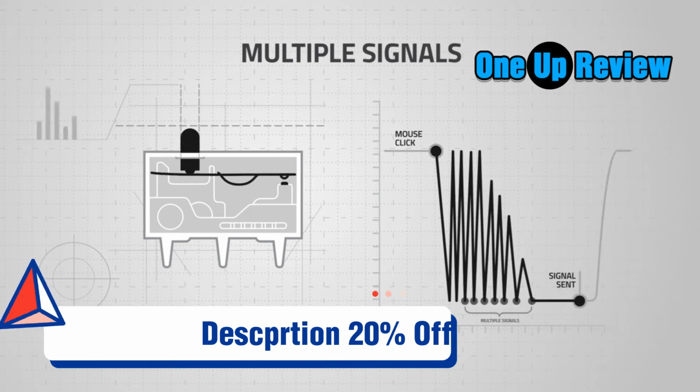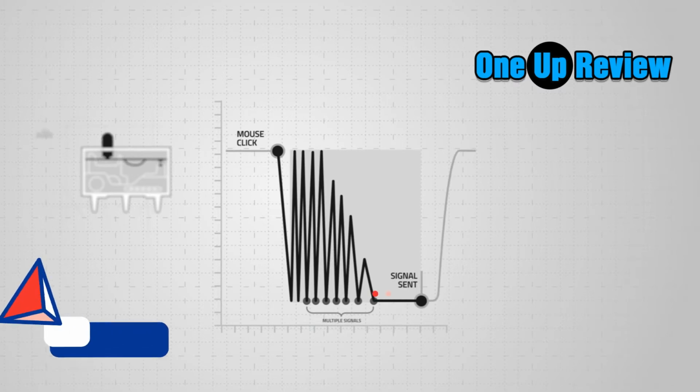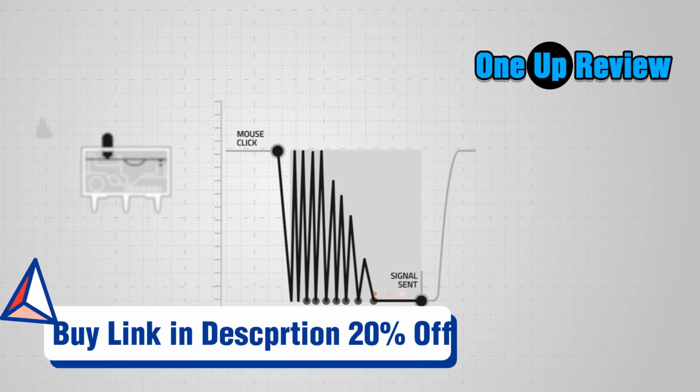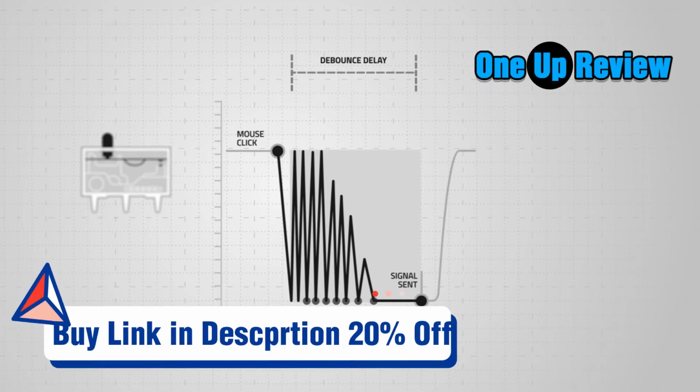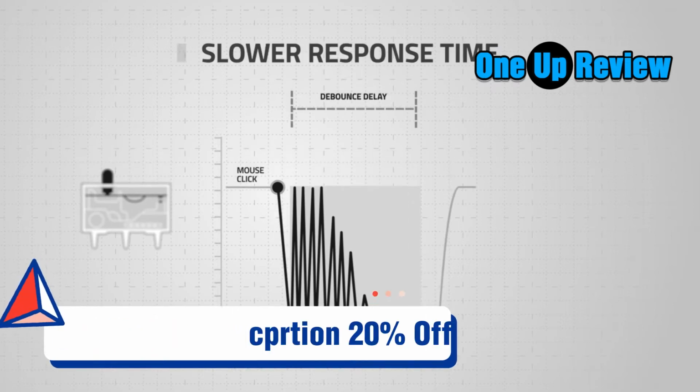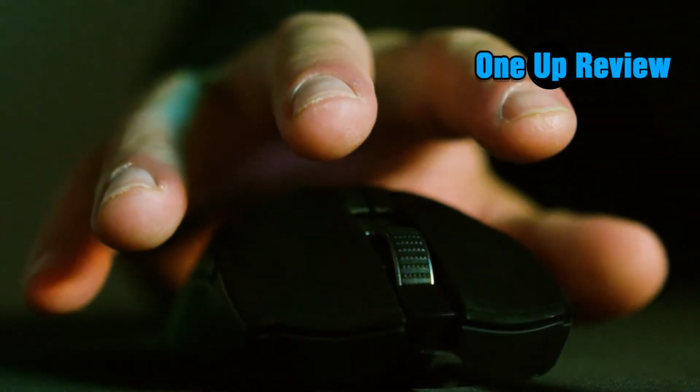To ensure that only a single click is detected, a debounce software is used to block out additional signals within a set period. This is known as debounce delay. The downside of debounce delay is that it results in slower response time. The solution is the Razer Optical mouse switch.